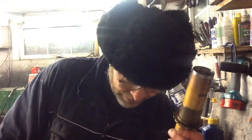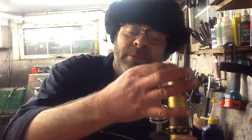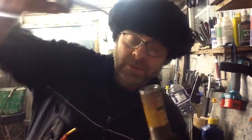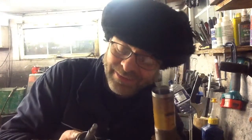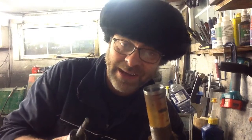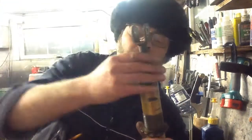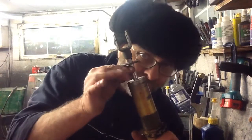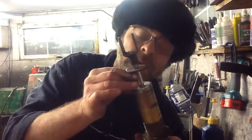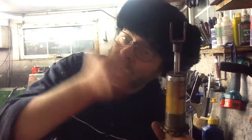Anyway, we're going to assemble this now. So, this will be an assembled rod. You'll have your piston assembly. That goes in. Yeah, there will be oil in it, okay, yeah, for the smart asses out there in YouTube land. Oh, got me own tiny oil in it. Yeah, I know that. Then this will go in. This block will then be pressed into place. There is a certain amount of friction fitting on this between the block and the O-ring. Once I'm happy that that is in as far as I want it to go, then we'll clean that over.